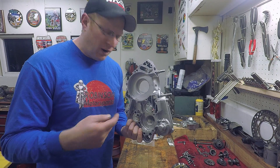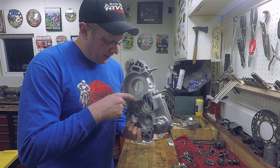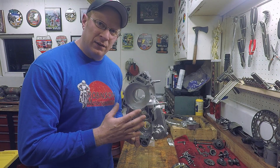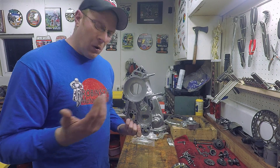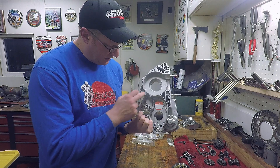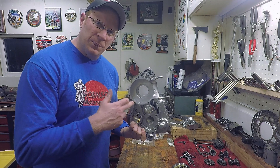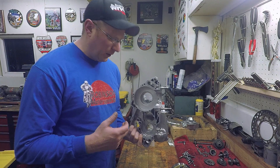What I did was basically pack that hole with JB Weld, screwed a bolt into it until I saw it coming out of that crack, backed the bolt out, let it dry, drilled it when it was dry, re-tapped it, and then filed it smooth. I already put the cases back together and torqued that down, so I know it'll hold the torque. It is on the inside and there's not much leading to the outside of the engine, so I'm not too worried about it sucking in air.